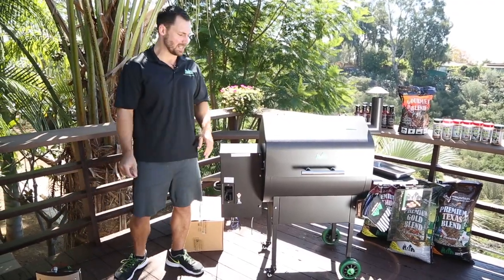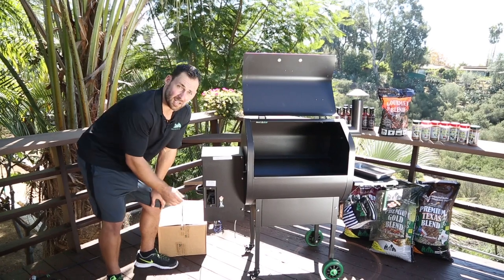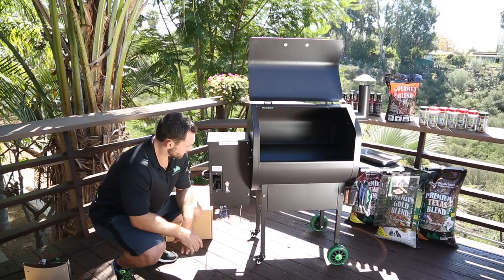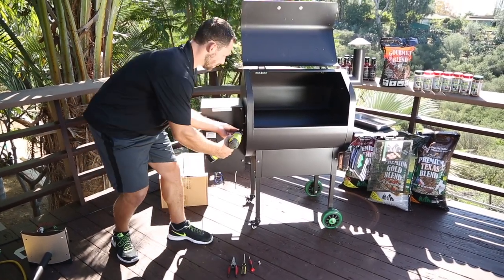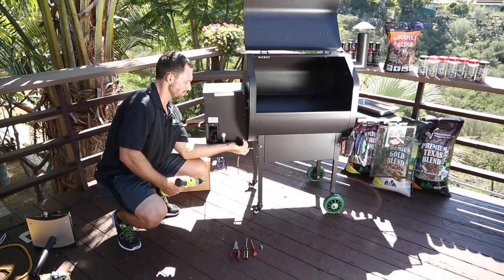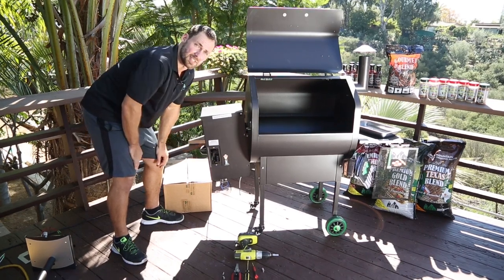To prepare for this replacement, I've taken all the components out of the inside of the grill. You can see right down into the fire pot, and we can access the Phillips head screws that help hold the auger assembly. I've also removed the control panel and unplugged the plugs from the back of it — that's going to free up your wires when you take the hopper box off. Remove the two 10 millimeter bolts on the front and two on the back holding the box on. Also make sure you've removed all the pellets out of your hopper box — as soon as you take this box off the pellets will go flying. There will also be some zip ties holding wires in place; you'll want to snip those and free up your wires.